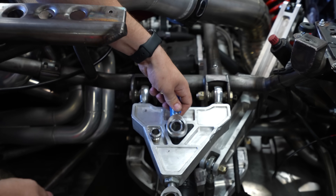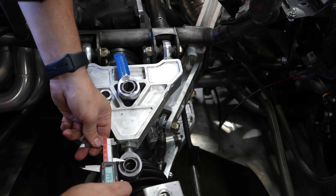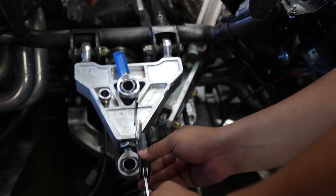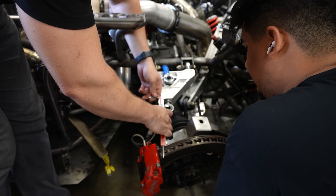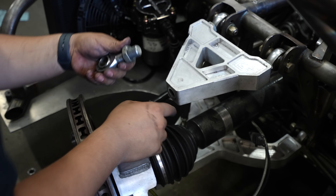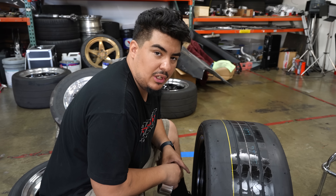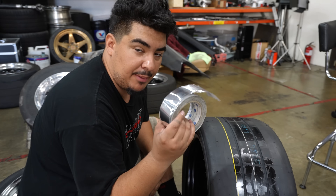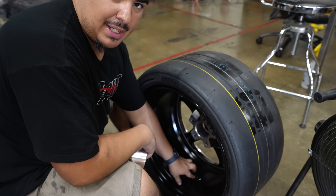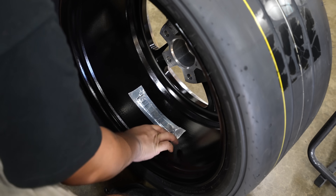The reason Isaiah and I both had calipers is we're going to measure something consistent — maybe the end of this to something for this. Estimated, there's 1.7 inches — I'm just looking from the top down. That's really deep. My favorite thing to do when getting new tires, getting the balance and everything, is aluminum tape for the wheel weights. The wheel weights aren't there with regular tape. I learned that from a Lamborghini team because you're going so fast it gets so hot — the regular ones are just kind of double-sided tape and those fall off real fast. We've had a lot fall off. We're trying to find some black aluminum tape but McMaster-Carr hasn't had it unfortunately, so you'd better stick with this bright stuff.